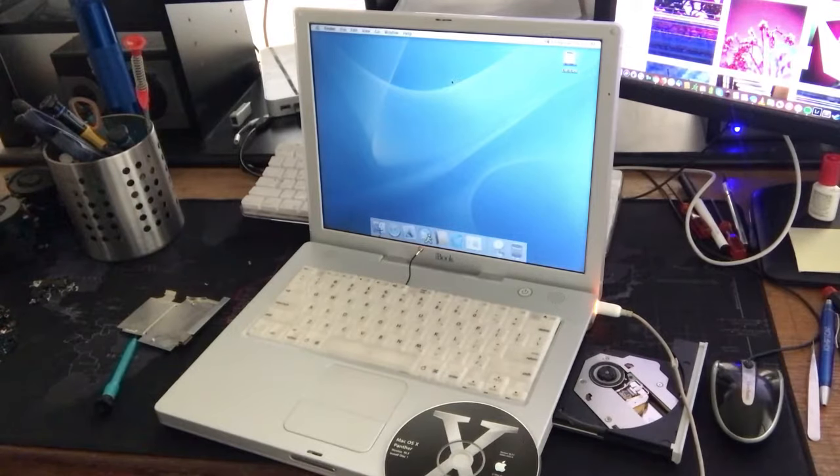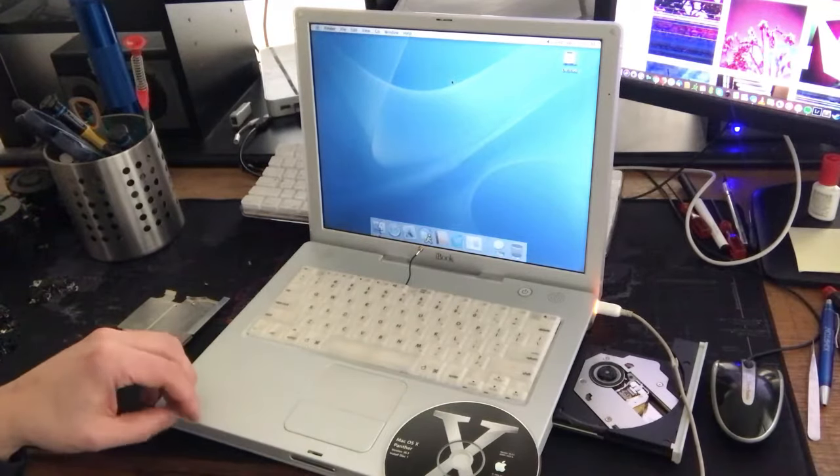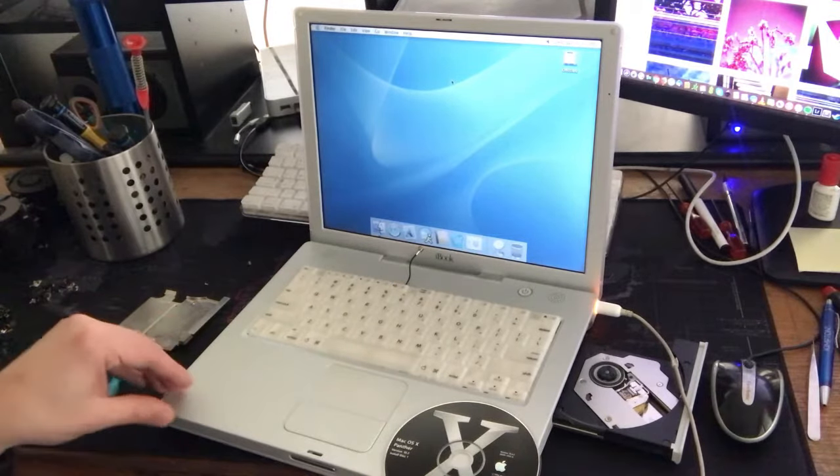Wireless B was pretty slow, and that card in particular was not very good with encryption. So to use that today, you have to basically turn off all your encryption and just have a wide open internet for that card to work. Even in the last couple of years that these were being sold to consumers, people would commonly call up and say, "Hey, I can see the SSID, but I can't join it." And that was because the encryption was too advanced for the card.